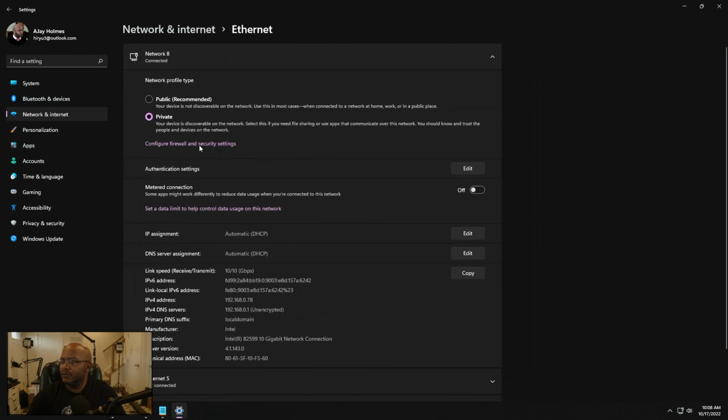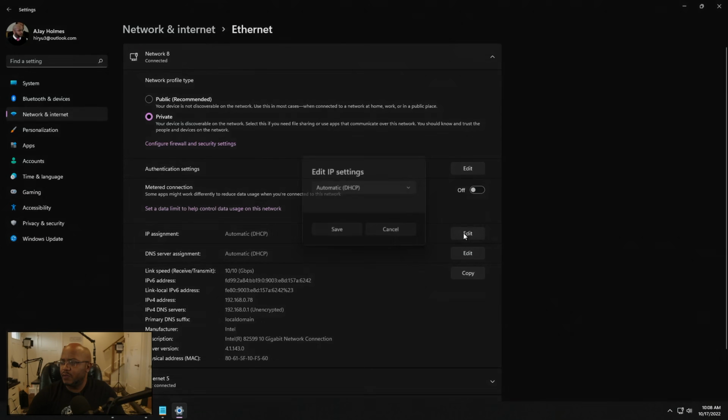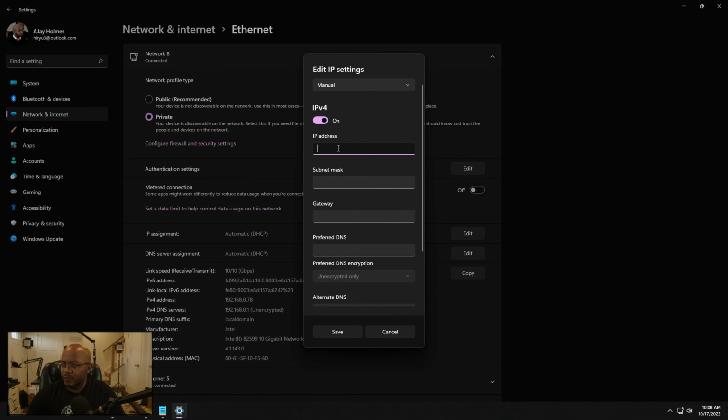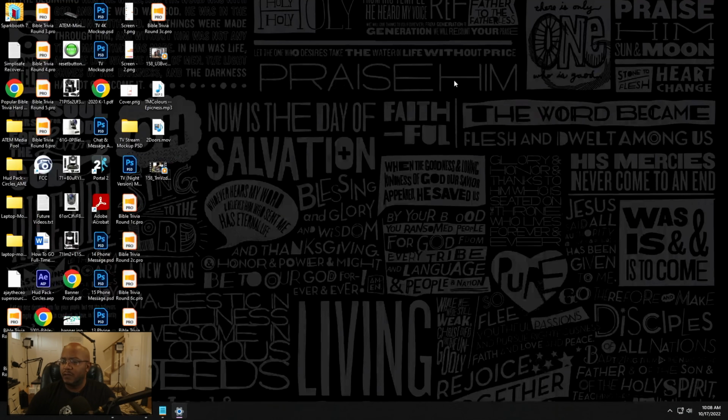And this is where we're going to go to our network. We're going to go to this one. We're going to change it in the range of what that one is. So that would be 192.168.1.something. So I'll just do 22. And on the bottom, it said it was 188 or 118. We'll figure it out. The gateway is typically 1.1, the same thing as the DNS. All that's dependent on your IP address range. All right, so there we go.